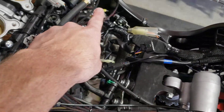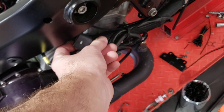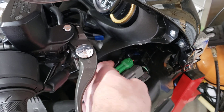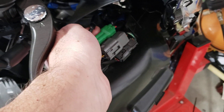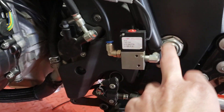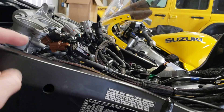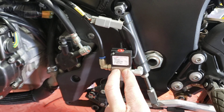Most of the wiring comes and goes in this direction. The O2 sensor plugs in over here, and the harness for shifter input is running up this direction and coming over here. Since this bike won't be using the horn, the horn connector has been pulled from its normal location and brought up here — you plug into just the negative side of the horn, which is a black wire with blue tracer. There's also a small harness coming up over the ABS so you can plug in the air solenoid for air shift or auto shift.